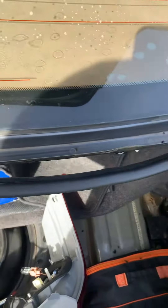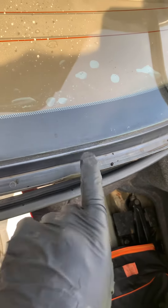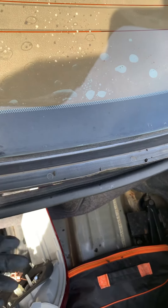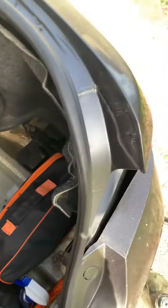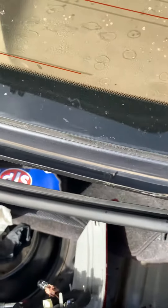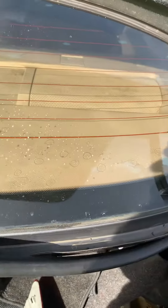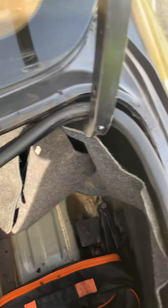Also worth mentioning, you want to pull your weatherstripping back along the trunk edge. I'm going to apply some weatherstripping sealant, because there was a bunch of gunk up in here. That will impede water from flowing down and draining — it's just going to collect and back up. As you can see, I just peeled this off and I'm going to clean this out real well. I cleaned it with some degreaser. Just get some paper towels and degreaser and clean that channel out, because if this channel is not clean, the water is not going to drain properly.